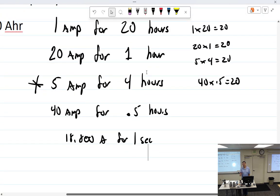It's not linear. Somewhere it's written, and I don't remember exactly where, but aircraft batteries were based on a 5-hour discharge time. But don't let that confuse you. You look at the battery, it says 20 amp hours. And that is 20 amps for 1 hour. But it more closely resembles 5 amps for 4 hours. If you really wanted to figure out where it is truest, it would be that 5 amps for 4 hours. Follow?